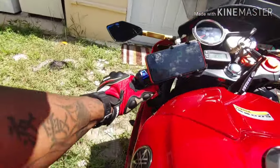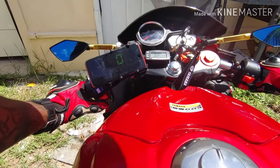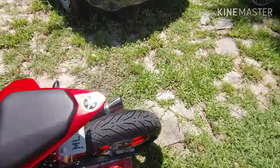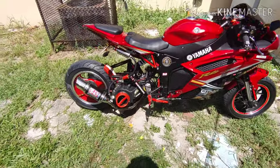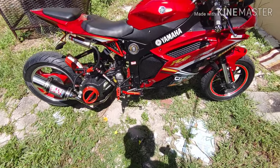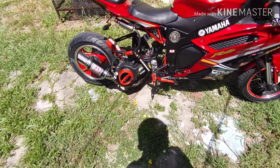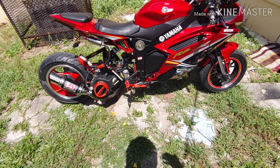So right now, I'm going to let you guys know, probably next video, what's going to be the best weights for me, because that's what I was planning before the video cut off. The weights for you might be different with the same engine. For people that have the 50cc, like I said, go look at my other videos. And if you do the big bore kit, you get an idea of what kind of weights you need to run with the kind of power you have.